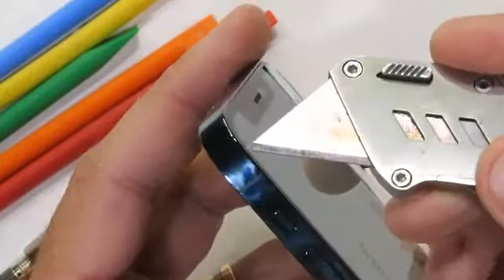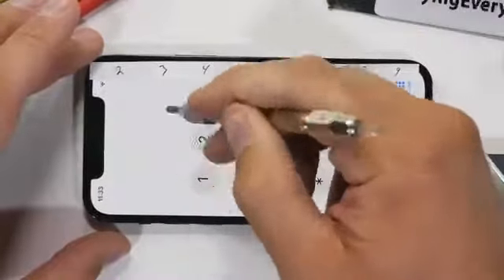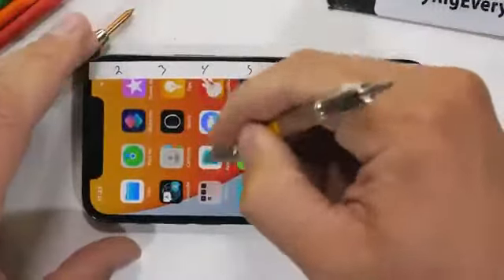Apple uses the phrase 'along with our new design, it makes the iPhone tougher than ever,' so it's not just the new glass. I think a large part of that 4x drop resistance comes from the design itself, with the glass sitting totally flush just inside the surface of the frame. A piece of glass has 6 sides — front, back, and all 4 edges — and with 5 of those 6 sides protected by the phone frame in a way most smartphones aren't built, it really does make the iPhone 12 Pro more shatter resistant.